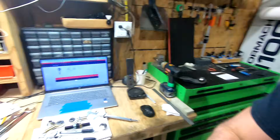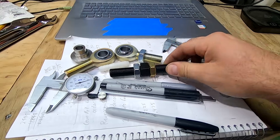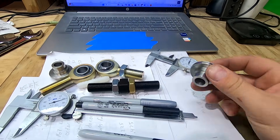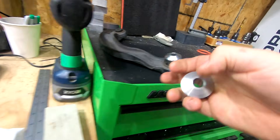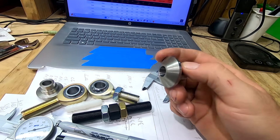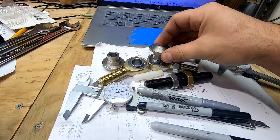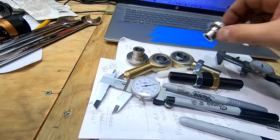The curve of these needs to clear the frame rail — the unibody — whatever you want to call it. But on the race car, that subframe stuffed into that chassis is a little different, so we could just do a straight shot, which is going to be pretty easy. We're going to have some rod ends. I was thinking about doing a double adjuster setup, but that's going to be a little more complicated than it's worth. This is the cone spacer, which is this piece right here — it's out of our vertical links. We need to make a new one because it needs to be offset just a little bit differently, and the size of the rod end it goes into is a little bit different.